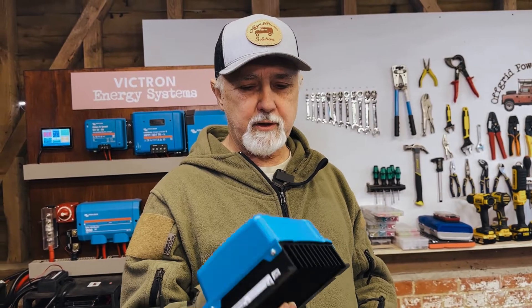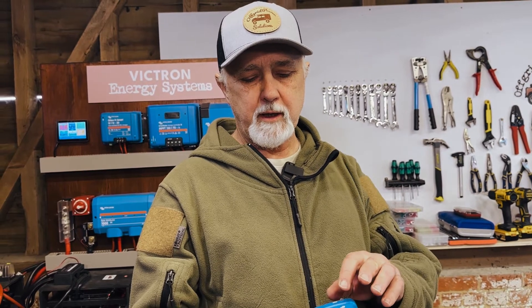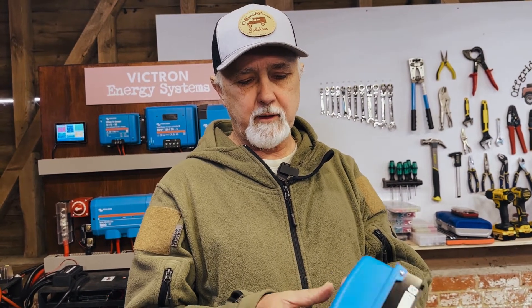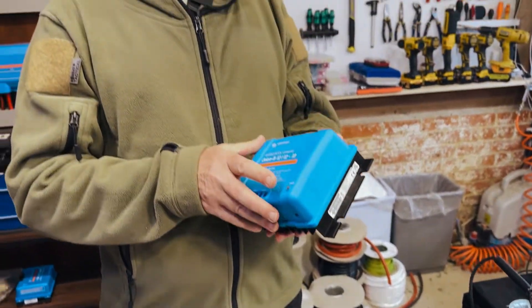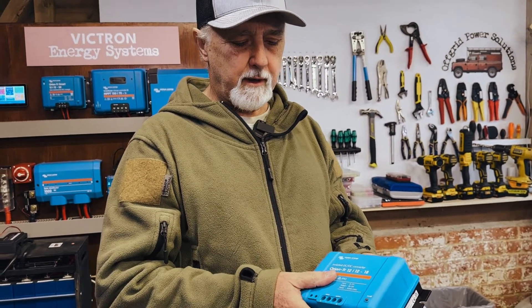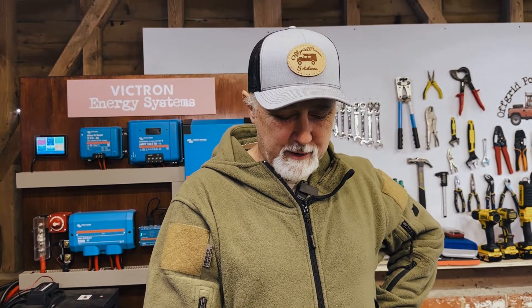So that's it in a nutshell. The charger is to charge your leisure battery from the starter battery, and you get them in 12-12, 12-24, and 24-12 configurations. Unfortunately Victron don't do a 12 to 48 volt, so you'd have to get something else if you needed that. Whereas the converter — recently we put in a 48 to 12 in a boat and that was quite handy. Hopefully that answers the question as to which you need for your situation. If you have any comments or feedback, really appreciate it. Hope you have a good day and see you in the next episode.